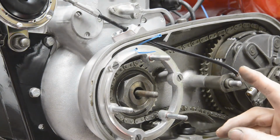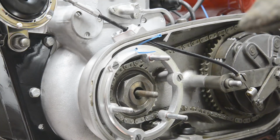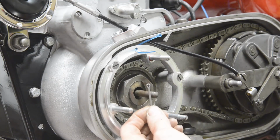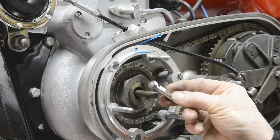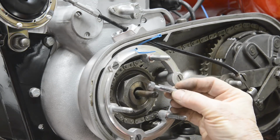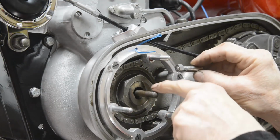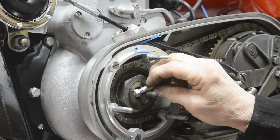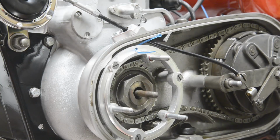But before we start that, I have a little erratum, I guess. Was it Gary commented on the last one? I had another senior moment and got my clevis pins and my cotter pins mixed up. This split pin here in the States is called a cotter pin. And of course what we would call a cotter pin is this here. This is your standard BSA kickstart one. And of course for us a cotter pin is a locking pin that has an angled flat face on it, that if this was a shaft here, that would have a flat face on it as well, and the two flat faces go in and lock at right angles. So anyway, I got it wrong. A clevis pin here is a clevis pin, but that split pin is a cotter pin, if that makes any sense.